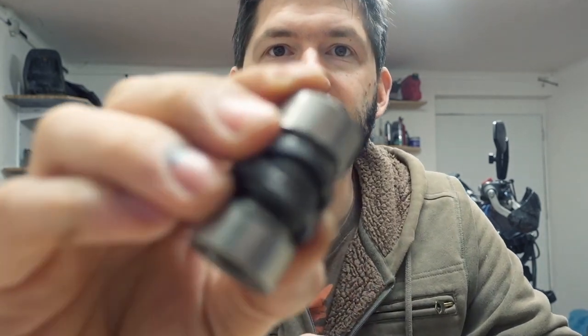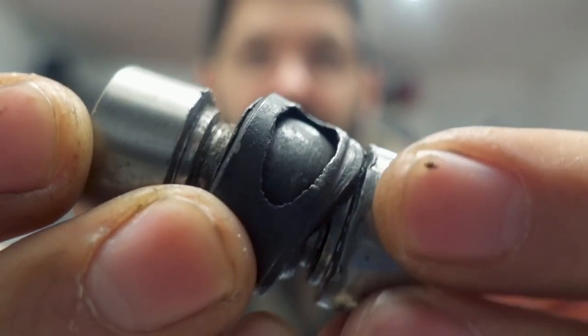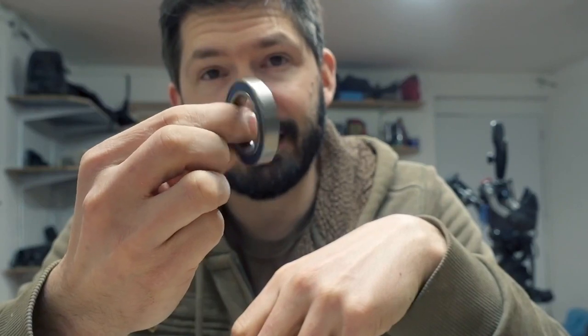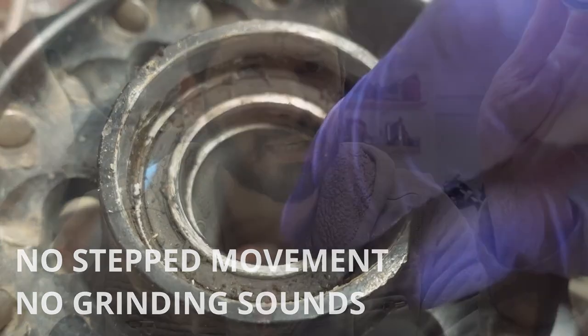This is how a spherical bearing looks when it's completely obliterated and dead — obviously that is wrong, it's very dead. When checking wheel bearings, if it makes a grinding sound and there's sand and water in it, that bearing is going to have a short life. It's still rideable if there's no big play and the inner circle is not moving a lot, but it's going to die pretty soon. A good bearing should have smooth running, no sounds, no play.